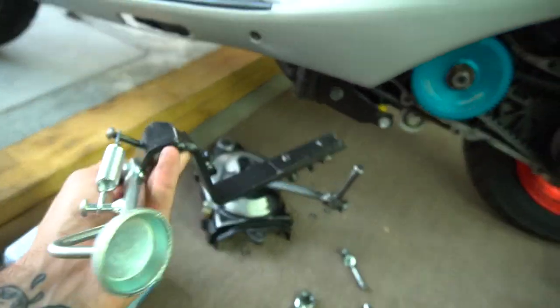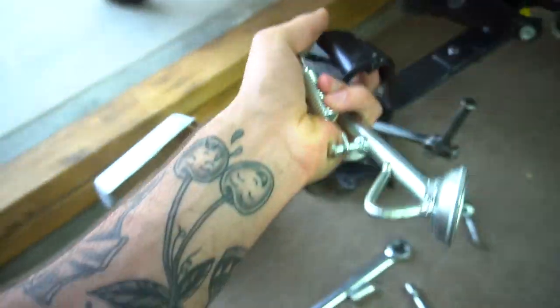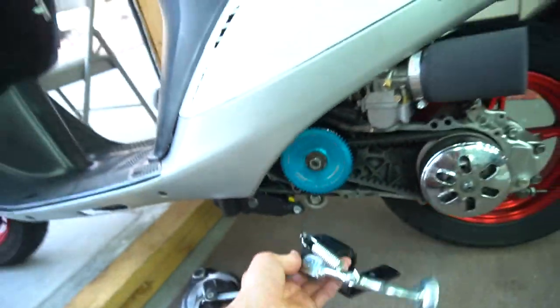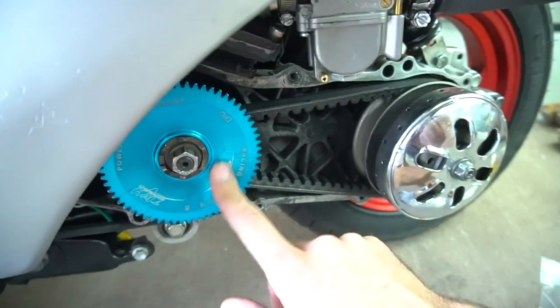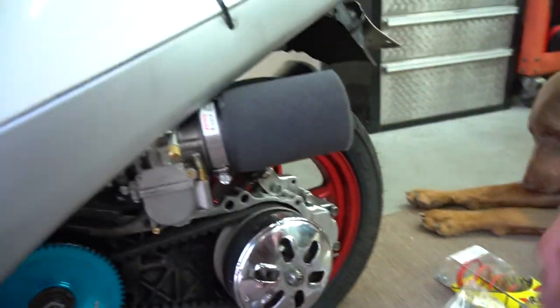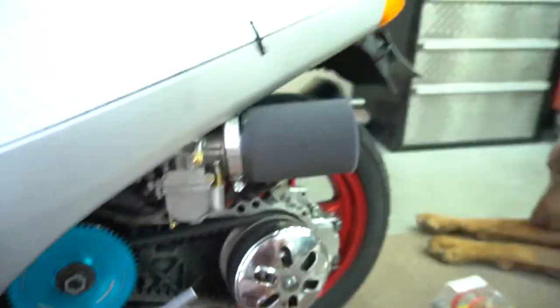I decided to get a side stand, but the only issue is I'm not too stoked on it - you have to drill into the bottom of your frame, which isn't a big deal, but I don't like where it mounts because it was hitting my kicker case when it comes up. I'm thinking I'm gonna cut it and weld it to the frame a little farther up. The one Chuck has is a round clamp that goes around the frame, which is what I wish I had. I'll run some washers to space out my kicker case so it doesn't rub.